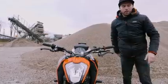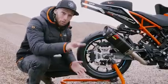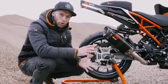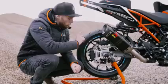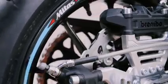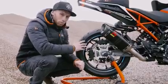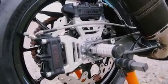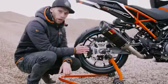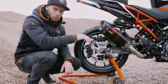Now for my rear brake extravaganza — the crucial part of every stunt bike. For the coming season we decided to go big. We went from a 230 millimeter disc brake to 300 — now I have like a big pizza on my back wheel. On top of that we designed a brand new bracket so I can mount big calipers on it. For the hand brake I have a four-piston caliper, and the same for my foot brake — so a lot of braking power, meaning my tricks will be much bigger and more aggressive.